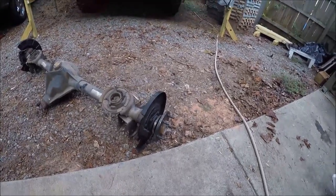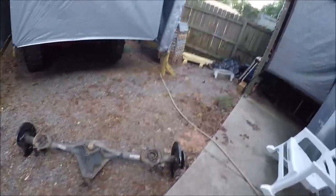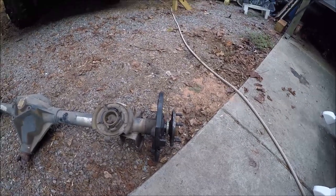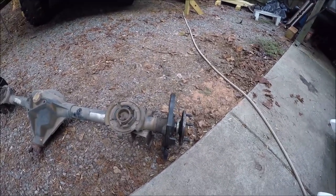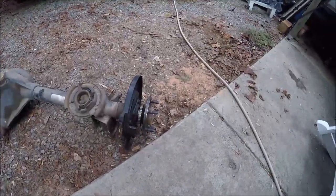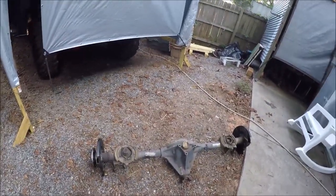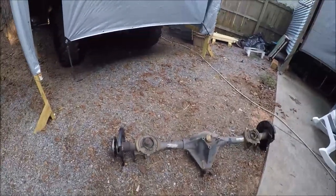The power and torque from the drivetrain is transferred through the axle shaft, and also the vehicle's weight is on the axle shaft itself. So if you break the axle shaft and have an axle shaft failure, the tire and shaft are going to come out of the axle. You know those crash videos from Russia where you see a tire go rolling with part of an axle shaft sticking out? That was the issue — that was a semi-float.